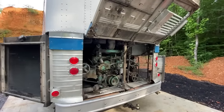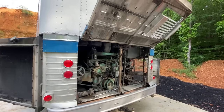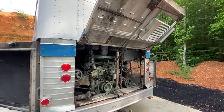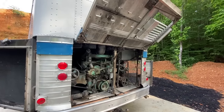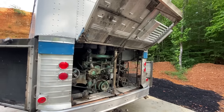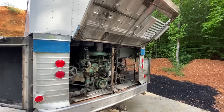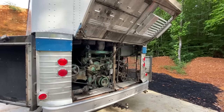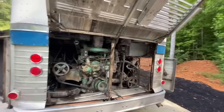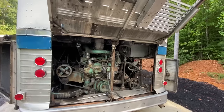I've shot video of me going up and down that hill multiple times, showing how I have to downshift. Even I have to downshift with my propane injection on there. But you've got to keep the RPMs up on these things. You can't lug them. The engine oil does a lot of the cooling on them too. As your RPMs slow down, you're not getting as much oil squirting up on the backside of the pistons, where they're cooled. There's a nozzle on the top of the piston rod that sprays the inside of the pistons with oil the whole time, keeping them cool. When you start to lose that, the pistons get really hot. They expand and they grab the liners, either galling them or cracking them a lot of times too, but I didn't see a crack. That's a good sign. I couldn't see any obvious scoring inside the piston there.